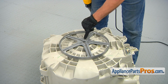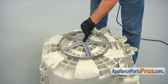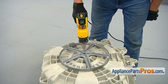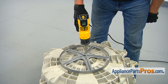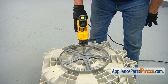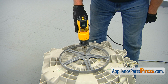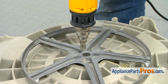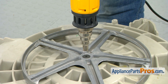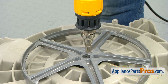For that we need to unscrew that bolt in the center. Unfortunately, the bolt is not obeying, so we're going to use a heat gun to break it loose. We're going to heat it for a few minutes. Take your time, because you're not going to accomplish anything if you just heat it for 10-20 seconds. I put it to the maximum. It's 1100 degrees, and I probably should spend maybe 2-3 minutes heating it up.